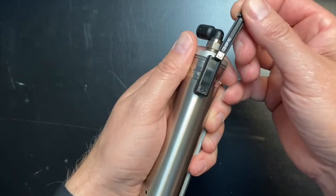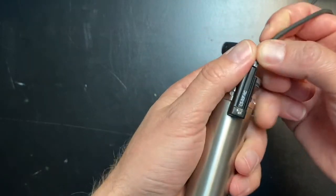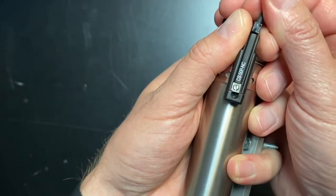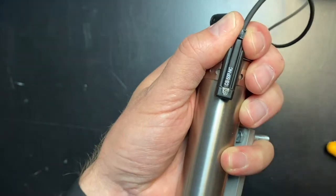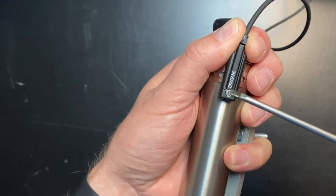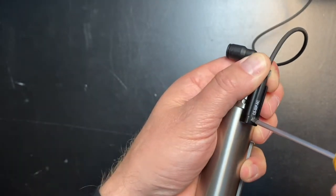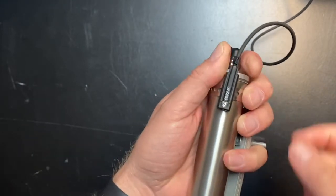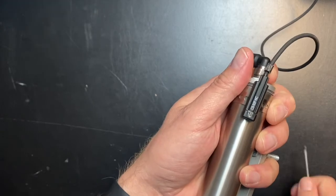You may now slide the reed switch into the reed switch clamp. To seat properly, it needs to slide in until the flathead screw is in the circle shape of the mount. Then take a flathead screwdriver and tighten it down to secure it. If you are having trouble sliding it in all the way, try loosening the screw and try again.